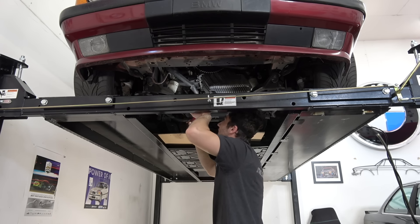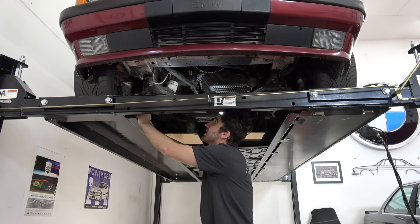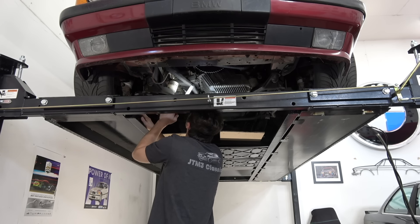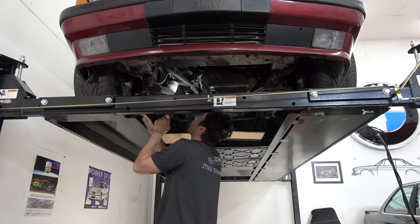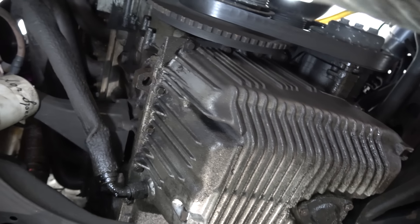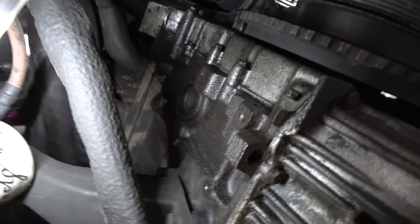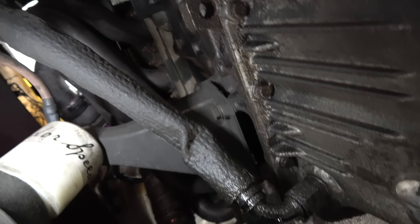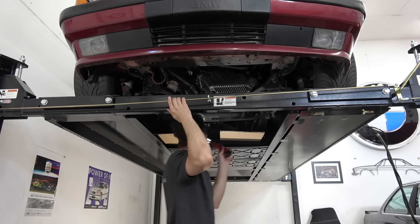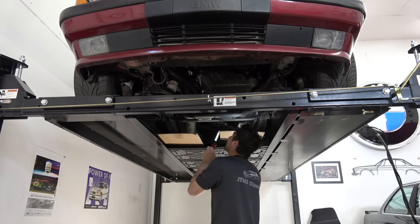On to the more important stuff. Turbo drain — pretty damn leaky. That needs to be addressed, but I kind of think I've been having this issue since day one, so that's ongoing. Exhaust manifold looks good — I don't see any cracks, and I don't hear any exhaust leaks when I'm driving it. Oil pan — that looks a little seepy. Timing cover looks a little seepy. Chain tensioner looks a little seepy. Valve cover looks like it might be seeping a little bit. Front main looks good. Rear main could very well be seeping — yeah, I think the rear main is seeping because there are some drips right there.